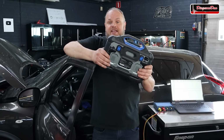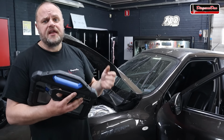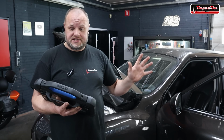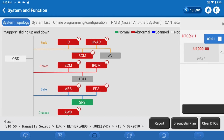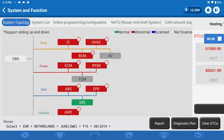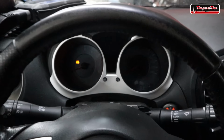Now, let's see if we can fully communicate with the vehicle again using the scan tool. I plugged the engine computer back in and I fully scanned the vehicle. Now we can communicate again, and almost all of the modules are red, which makes sense because there were mostly communication faults stored. There are two gray modules. One is not equipped and the other one is the TCM, which of course is unplugged.